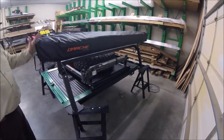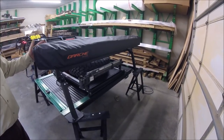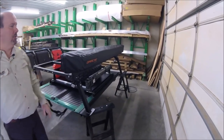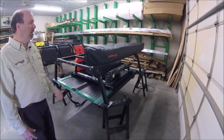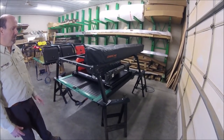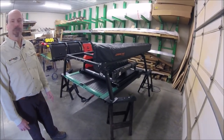This one has an extended height awning. Typically we hold them much lower, but the owner of this truck has a big 270 awning that's eight feet long, so we extended the racks up high. It's a six- to seven-foot awning here and the eight-foot awning will continue over the cab of the truck, then swing out all the way around as a 270. We needed that height to clear the cab. We can do that on the Tech Series racks as well — it's not specific to the Ram Box, it just happened to be specific to this order. Lots of different features here with the Ram Box bed beyond just the small cargo area given by the side box.